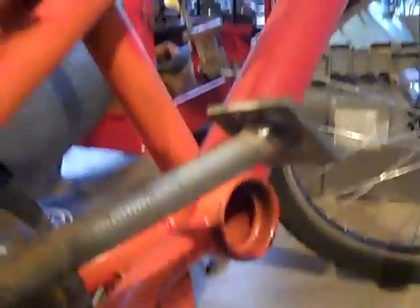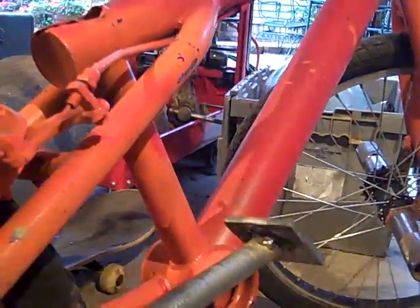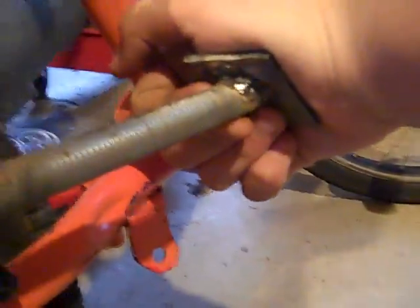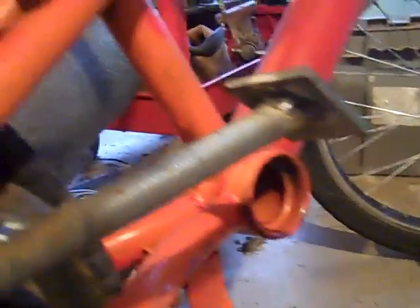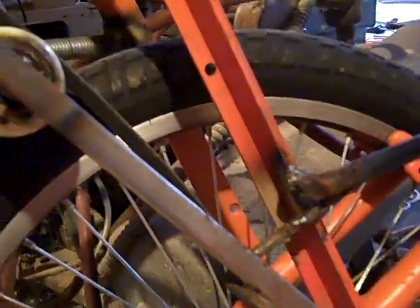When you want to engage the engine — we don't have a throttle hooked up yet, but we'll just pull it for now — when you set whatever throttle you want, you depress this. As you can see, it's a little squeaky, but it tensions the belt, letting it move the wheel. So we have got it running, kind of, but here's our problem.